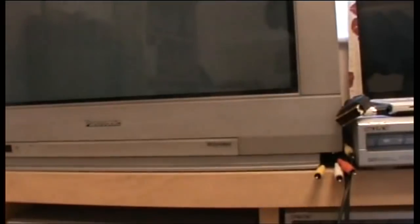Right, there we go. You might not see it but you can hear it — I've got ghosts. It's a black screen but in the background I can see everything: weird characters in the background. You don't get a signal. That's because the AV2 socket on my television does not accept an RGB signal. This is the problem you're having when trying to record your games on a DVD recorder.